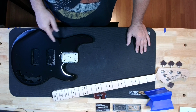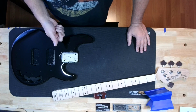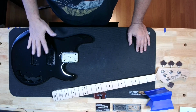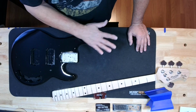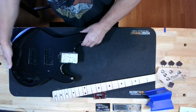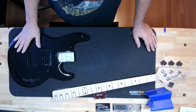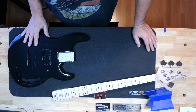Then once I got that all sanded down and nice and smooth, and I go, okay, I'm ready to put top coats on. Same thing, Spray Max. I used a hot rod. It's not a gloss paint. It was direct to metal paint, but because I was using the same manufacturer, same product line from primer to top coat to clear coat eventually. It's a black, and you can see it's a satin black. It's kind of flat. Now it was even flatter than this until I put 5 to 6 coats of black on it, on the primer.